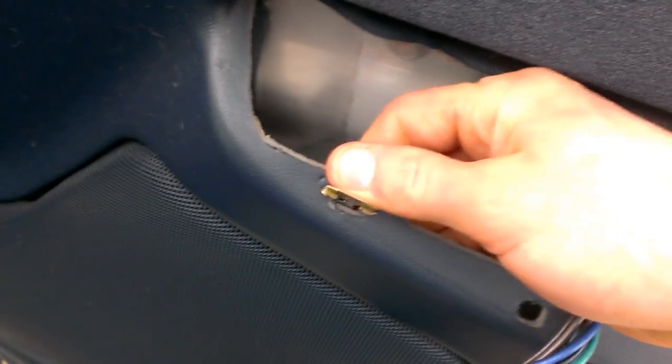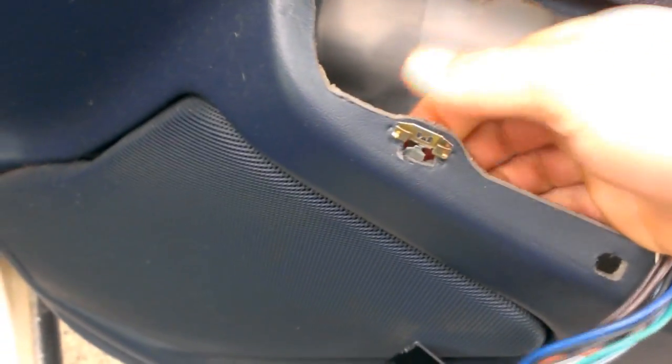So you're going to loosen up those two screws, and then that should happen, but I wasn't ready for it to happen. Then you're going to remove your little trim piece. If your clips happen to get stuck in there, all you got to do is get underneath them, push in kind of on an angle, and pull them out. And then they just go back on here. See, this has been done so many times in my truck, the plastic's getting a little used and abused, if you will. You push them back on, and you're good to go again.